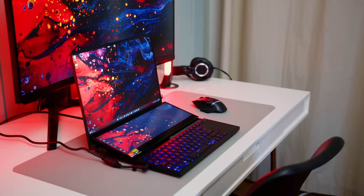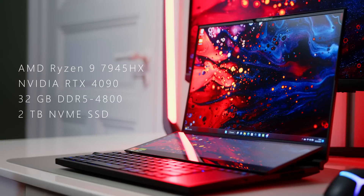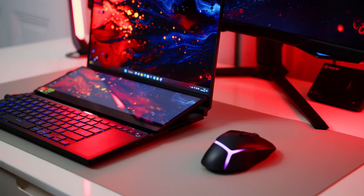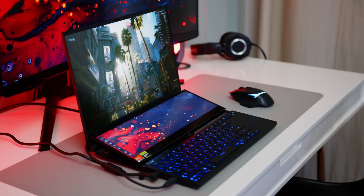The dual-screen laptop is every bit as special as it was when we reviewed it last year. And while the chassis remains mostly unchanged, this puppy is fully loaded for 2023. Alongside the new AMD silicon, ASUS also opted for NVIDIA's RTX 4090, running at up to 175W. 32GB of DDR5 4800 RAM and a 2TB SSD in our review sample. The secondary display remains unchanged and is basically half of a 4K screen, but with a glossy coating. The main screen gets the mini-LED treatment this time around and refreshes at 240Hz, so it's most likely the same panel as we already tested in the M16 a few weeks ago.